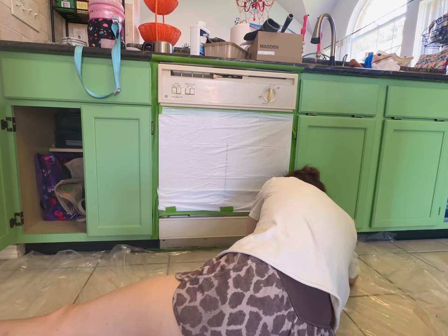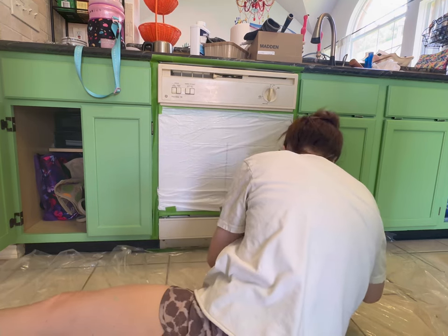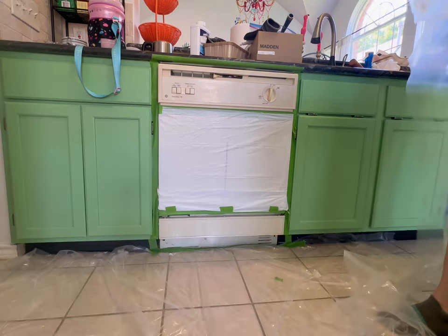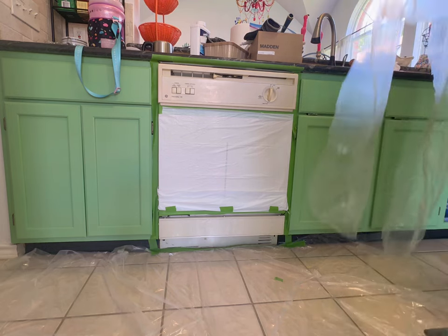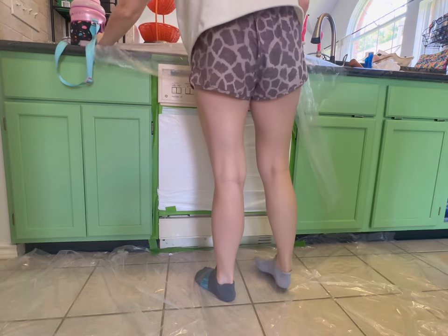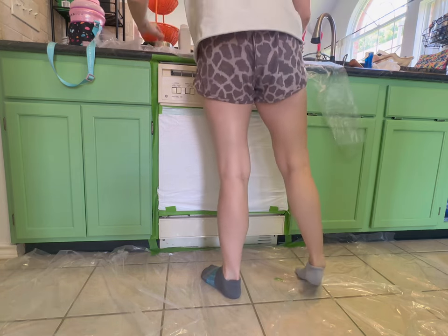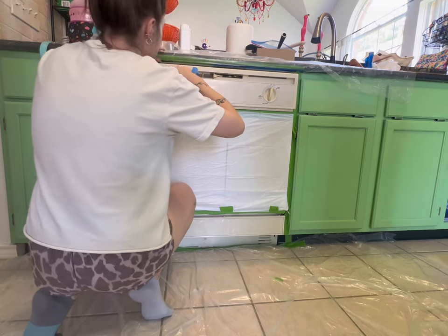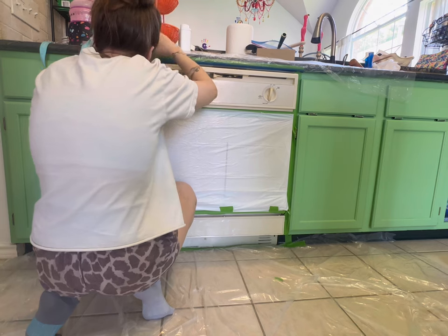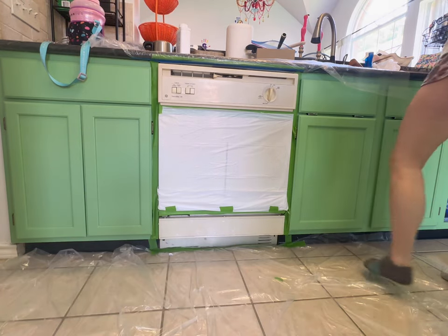The spray paint I'm using for the plastic top and bottom is Bare spray paint in the color 'Hopeful Dream' — it's almost a lavender color. I thought it was more blue than it turned out to be, but it's still beautiful. I was able to use regular spray paint because I have plastic appliances, so I sanded and prepped the area. If you have stainless steel I'm not sure how it would turn out. Be sure areas painted with regular spray paint don't get super hot — I used high-temperature spray paint for the glassy middle section. Supplies are simple: tape, tarp, spray paint, and sandpaper if your appliances are plastic.